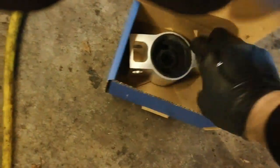So we've got our new bush here. It's important to check on these as well, because these are sided — they're a very slightly different shape. You can pair it up to the old one. You can see it's got this little indent, which gives you some clue as to which side is which.